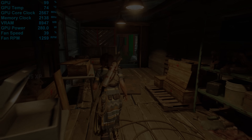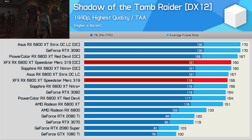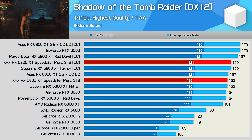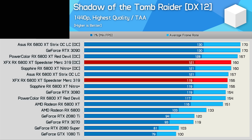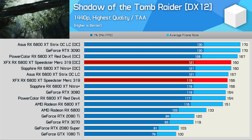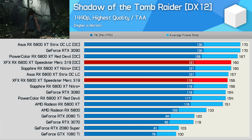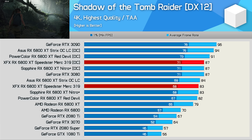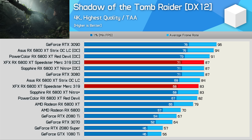Looking at out-of-the-box performance, the Merc is comparable to the Sapphire Nitro Plus — both delivering 156FPS on average. The overclocking performance wasn't amazing, only matching the 2560MHz overclock of the Nitro Plus, while the Red Devil hit 2.7GHz and the ASUS Strix OC reached 2.8GHz. Given the PCB design and quality cooler on the Merc, I feel it should be able to match the Red Devil. At 4K, again identical performance to the Nitro Plus both stock and overclocked — 5% faster than AMD reference stock, and 10% faster once overclocked.